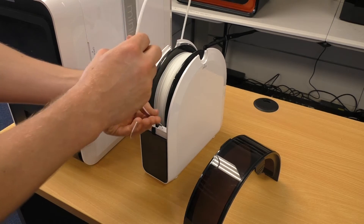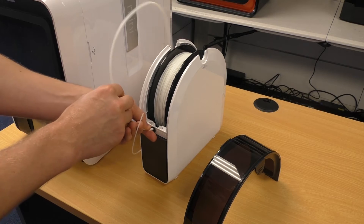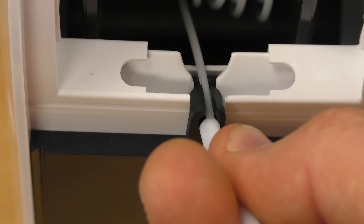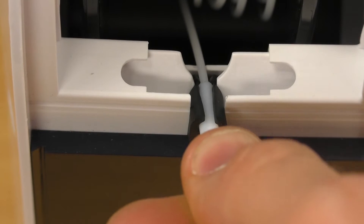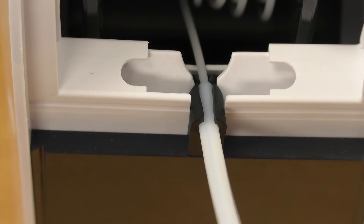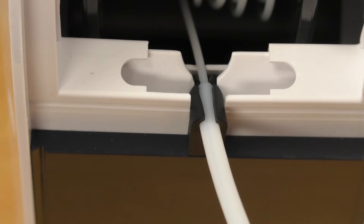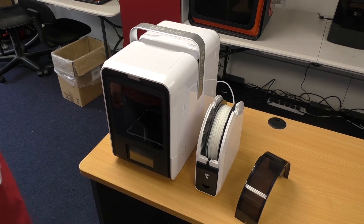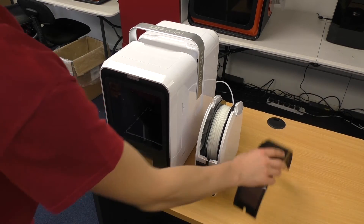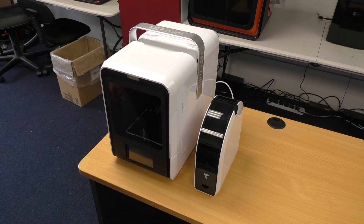Once we've done that, the feeder tube should be inserted down to the rubber grommet. See how the filament's sitting nicely inside? Push the feeder tube all the way through — that's going to reduce any friction from the rubber affecting the filament and instead it will hold the feeder tube in place. Set your filament cartridge so it's about 10 centimeters away from your printer and put the cap back on the filament holder.